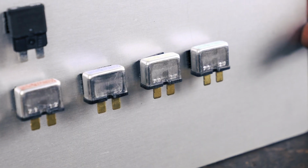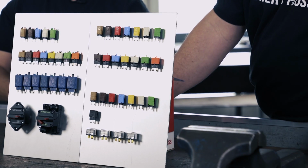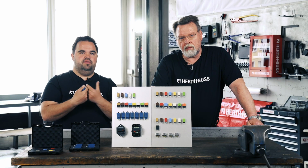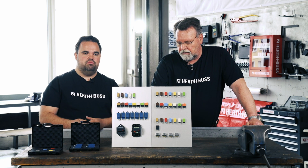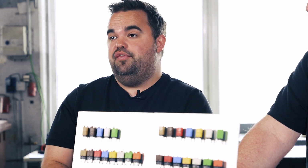And finally, we offer the bimetal type of circuit breakers. These breakers trip when they become too hot or are subjected to excessive strain. However, they automatically reset once they cool down. These are also partly available from the original equipment, OE, as they are initially installed in the OE. Furthermore, you have the option to purchase them from us for retrofitting or replacing them during repairs.